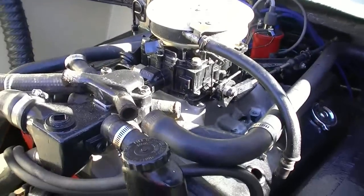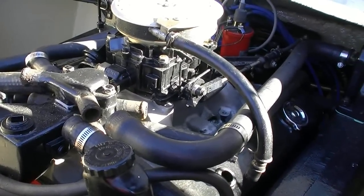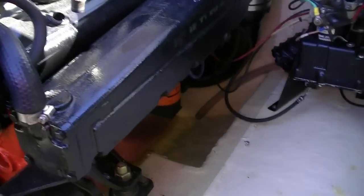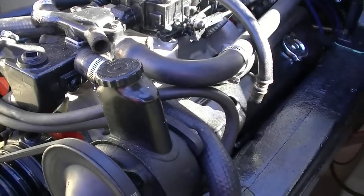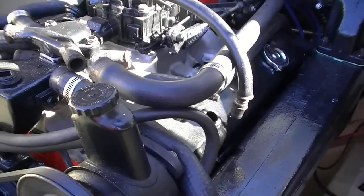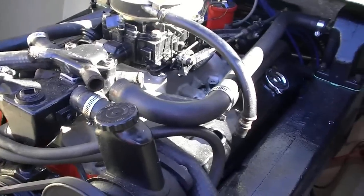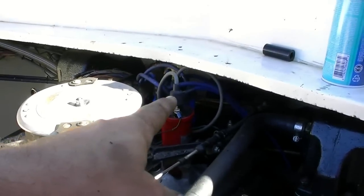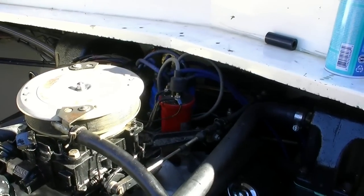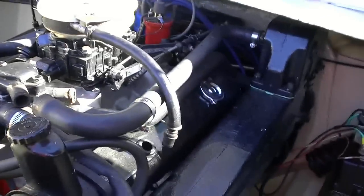Alright, so right at 2 hours it took me to completely winterize the boat, and everything is done. I got all the spark plugs out, squirted a little fogging oil down in there. I inspected all the spark plugs. Now when the spring comes around, I'm actually going to replace the spark plugs, change the oil, all that kind of good stuff. I'm just trying to put it to sleep for the winter to keep it from freezing to death. And I'm also going to switch over to a Petronix electronic ignition when it comes springtime. So it's asleep, it's dormant for the time being until we de-winterize it.